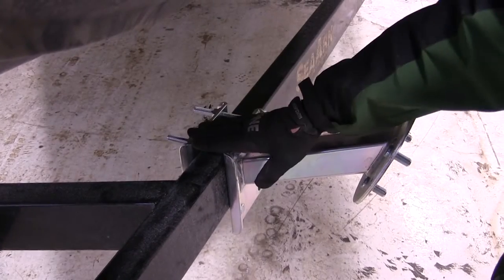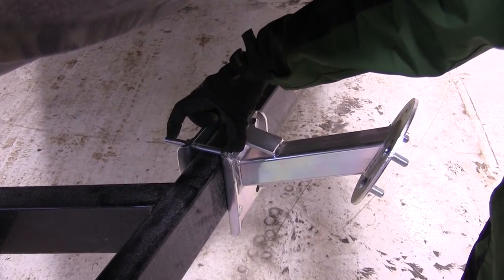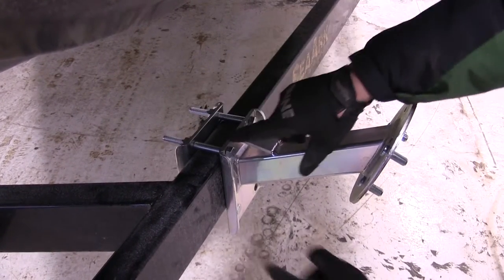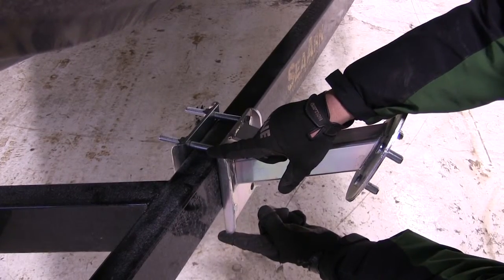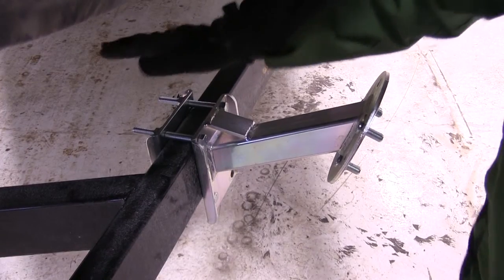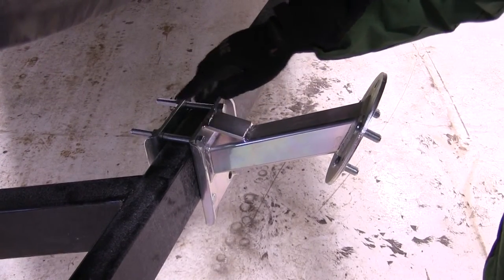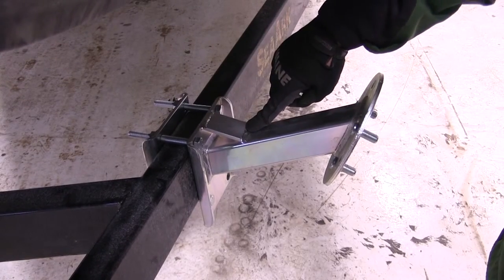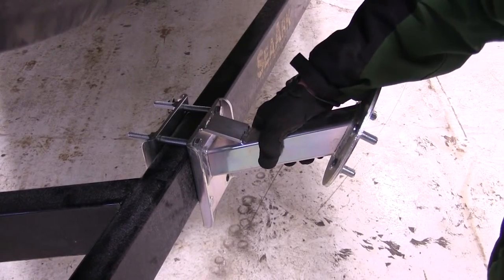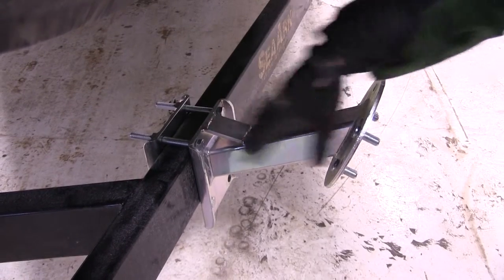When bolting to our frame, the carrier is designed to fit a maximum width of three inches and maximum height of five inches. The carrier and hardware is zinc plated with a tough plate finish that has three times the corrosive resistance of a standard zinc plated chrome process and thirty percent greater resistance when compared to powder coated finishes.